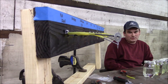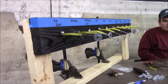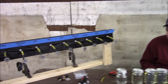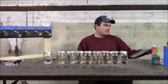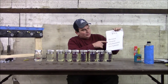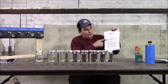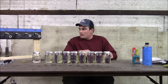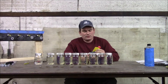Ethanol is far less damaging than a lot of the toxic additives that make up today's gasoline. I would challenge you to find a mechanic that has done this test or has looked into fuel this extensively. Some of these additives, especially in regular gasoline — BTEX: benzene, toluene, ethyl benzene, and xylene. In my last fuel soak test, I actually singled these out and soaked fuel lines in them. After a week they were like a noodle — they absolutely failed. I soaked another on the end there for a month and it didn't really do much.